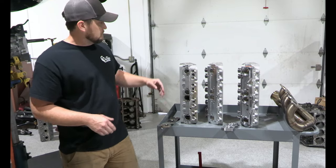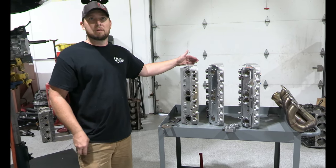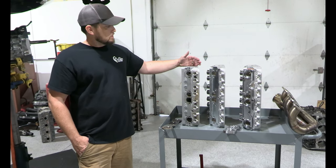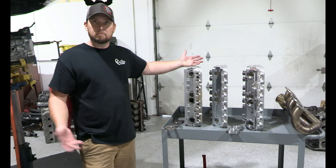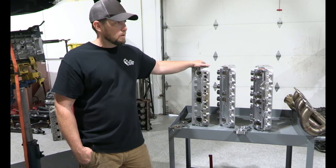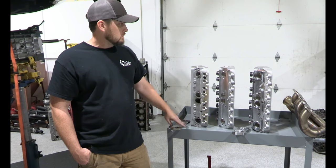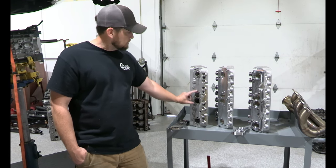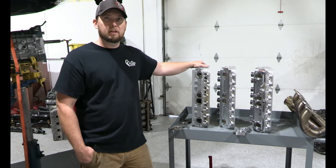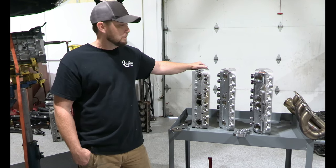And we thought this previous year, I mean, we've changed the turbo kit basically every year because of this problem. First turbo kit did good, but we didn't make a lot of power. We wanted to step the size of our tubing up, just to see if that mattered. It's all kind of experimentation. We went to a 2-inch primary and we thought that would make it stronger. Of course, we thought the adapters would make it stronger, the whole flange setup, instead of just being the bolts relative to the port. So obviously we did a lot of things to improve it, but it didn't improve it. I mean, it may have to a small extent, but here we are.